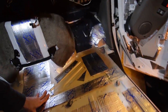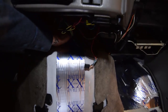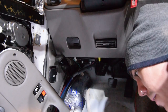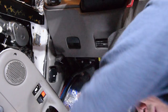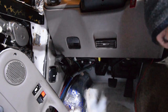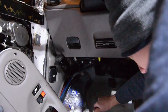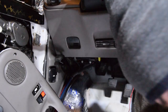For reference, two five-foot pieces got me the whole front floor and one big piece on the main panel — coming all the way back to about there. I think one more piece will cover the rest of this front area. For the tight intricate areas like this wheel well, I'm using small pieces stacked and doubled over a little bit, because when it rains this thing vibrates like crazy and you can hear it loudly. There we go — that wheel well is totally covered. There are also spots by the firewall which are real thick, but I'm still going to cover those.